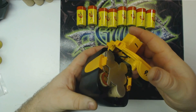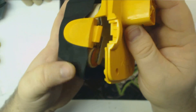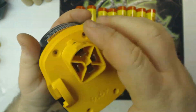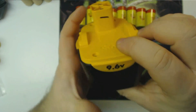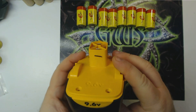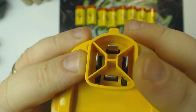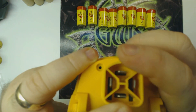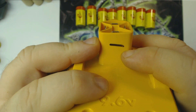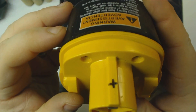We're going to lift off the top of this battery pack. Now there are going to be some wires attached to the battery pack, so you want to be careful. In this particular case we're going to be replacing those wires too because the quality of wire they use in there isn't the best. One other tip before I get ahead of myself: before you actually remove anything, take a multimeter and figure out — as you can see there are four tabs in here. The two on the sides are not connected to anything, but the one in the front and the back are. Figure out which ones are positive and which ones are negative, and mark it on the outside of the case. So I mark positive there, negative on the other side.